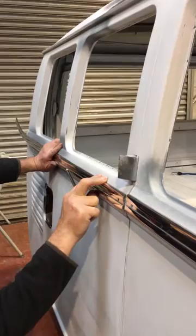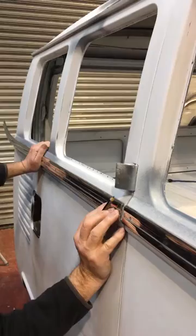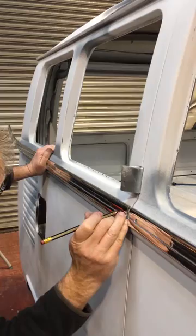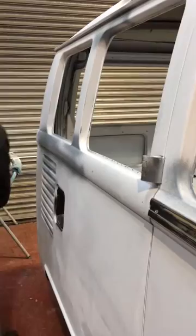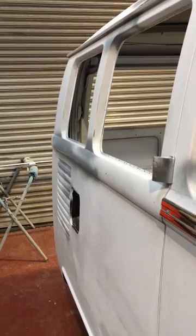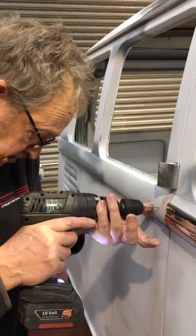We have pressed a curve, making it easy to fit around the compound curve of the rear corners. This curve must always point upwards. To fit the short side trim, measure and mark the location relative to the cargo door trims. Leave a 2mm gap from the door edge for an end cap. Drill and secure the trim. Measure and mark the trim just before the vertical seam between the side and rear corner panels. Secure with a screw. Put a third screw midway between the two you have just fitted for added support.